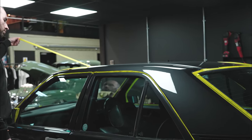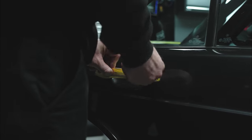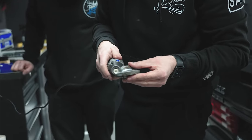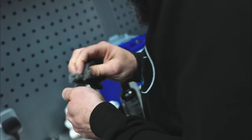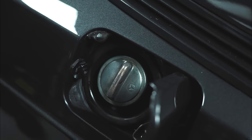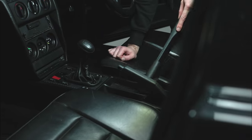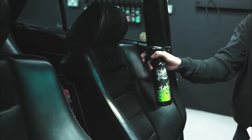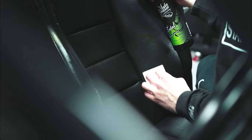With the paint correction and refinement stages complete, we remove any masking tape from the trim and surrounding rubber areas, and then turn our attention to the finer details around the car. It's the finer details that really make a job stand out — in this case we took off pieces looking a little worse for wear, like the fuel filler cap, using Mercury metal polish with a polishing wheel attachment on a Dremel, some wire wool and elbow grease to restore the shine. We then turned to the interior, starting with a thorough vacuum of all surfaces using a crevice tool with a brush to get into all those nooks and crannies.